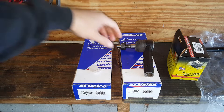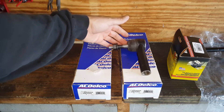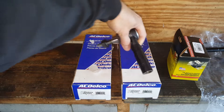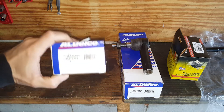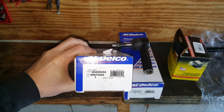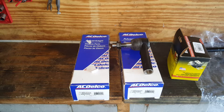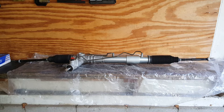You only have the pressure and the return line. Here's the outer tie rod I'm going to be going with — I like how these have the hex, like the OEM. These weren't too expensive. AC Delco are really good, so these are the ones I went with, and they're the same for both sides. You're also going to need some ATF Plus 4 to put back in — that's what they call for, or something equivalent.